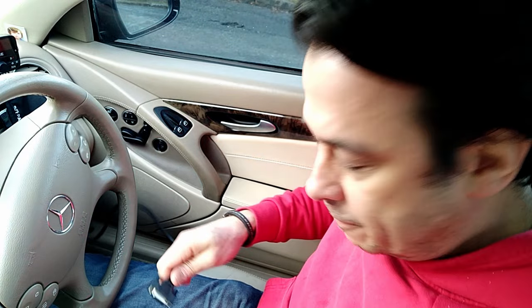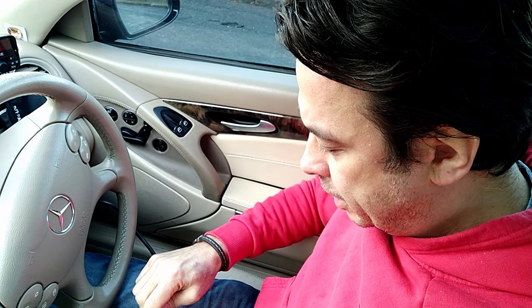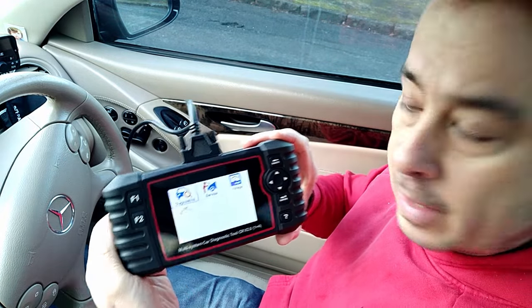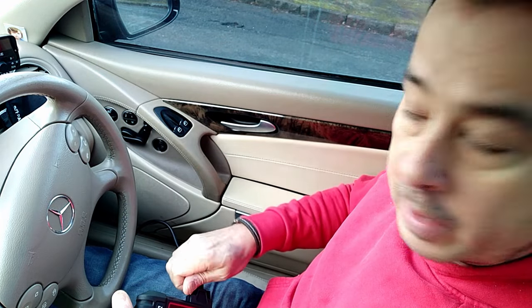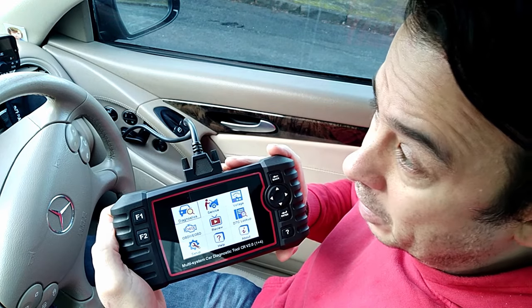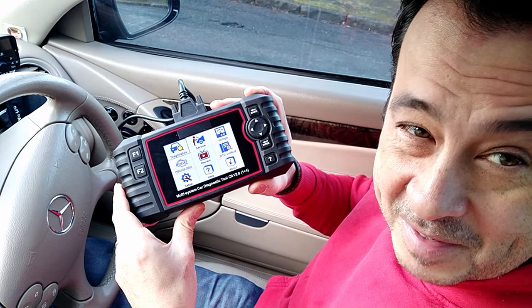So today I'm in a Mercedes SL. It's a 2004 and it's a 3.7. When you plug in the OBD2 to the car, make sure your car is in the on position on the ignition. That beep just tells me that this has now got power. The unit itself is powered by the car. You can turn the engine off if you want, or you can just turn the key to just before it cranks. Later on in the video I'm going to show you a little tip that not many people know about - how these things are even more useful and value for money than people first think.